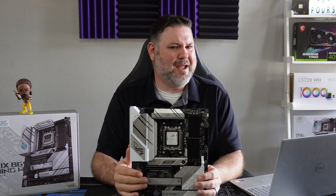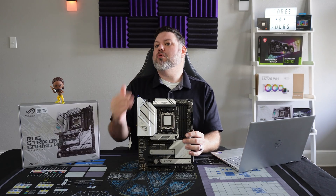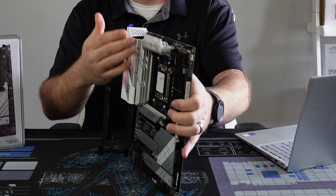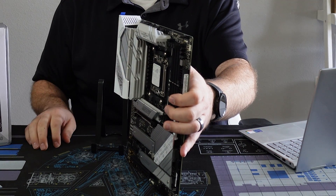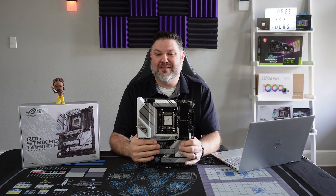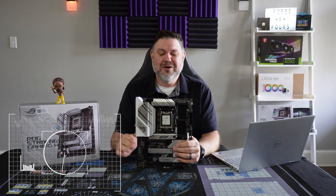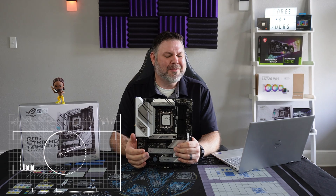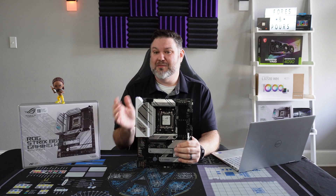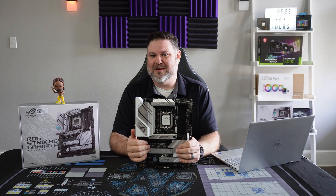However, if that is you, you're probably not looking at a B-series board to begin with — you're more than likely going to go with one of the higher-tier X670E options. The board offers more than enough power to handle a 7950X, as well as fairly substantial heat sinks over the VRM to help with cooling. If you are running a 7950X and you're not a hardcore overclocker, you're probably better off dropping that chip into eco mode or running a lower-power custom tuning to get the best results and stay on your efficiency curve.